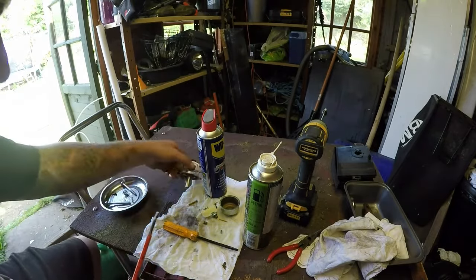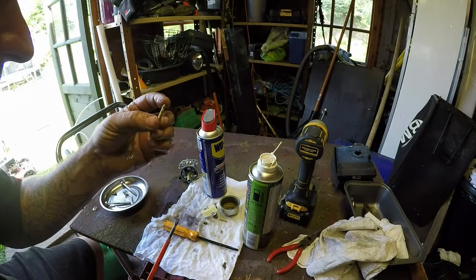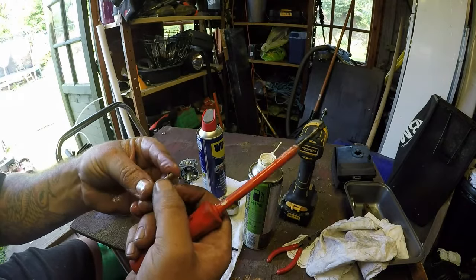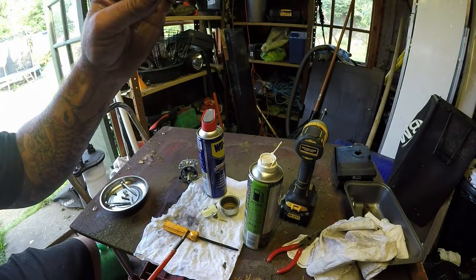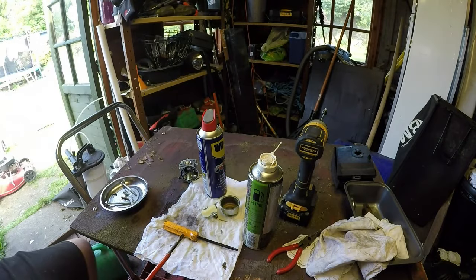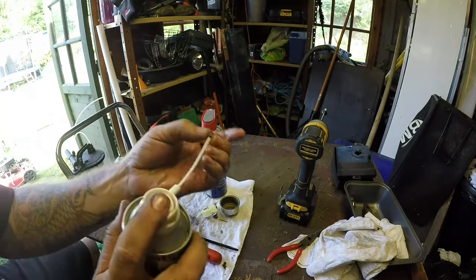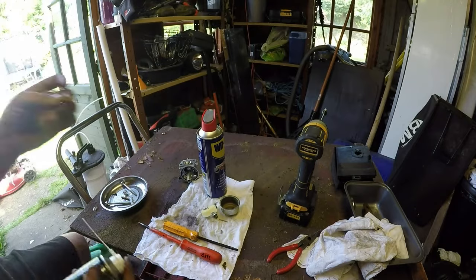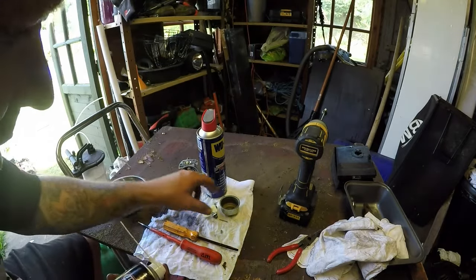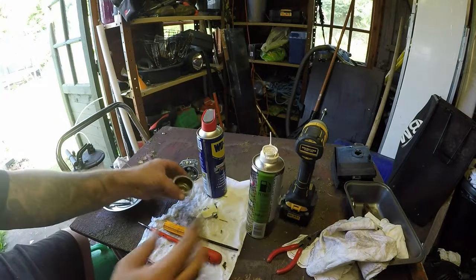There it goes. There's a tube, and yeah, that's all gunked up. You can see it is really badly gunked up. And the main one, yeah, there's a bit of daylight through there. Nothing excessive though. Let's see if that improves it. Yeah, I think I'll file that one out though. Bit of cleaning to go on in the main bowl.